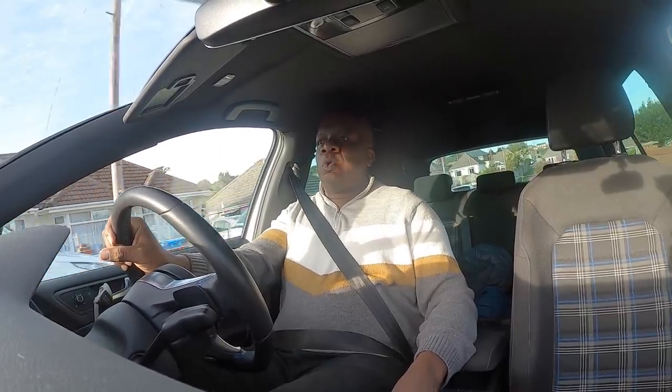Now, how does it feel when you're driving? Well, it certainly does feel powerful. It's a noticeable increase in torque, and also the petrol motor, the ICE, internal combustion engine, if you're wondering what ICE means, has a noticeable increase in power as well. So when you're driving the car, it does feel a lot more powerful, and where that power comes in is straight from launch. So from 0 RPM, you get that big hit of torque, and then when the petrol engine kicks in, it also kicks down the gear, so you get that continuous increase in power. That quickly drops off, as you saw in the scale in my remap.